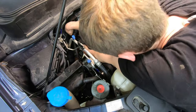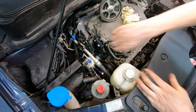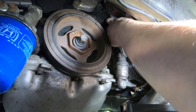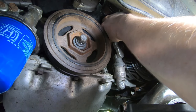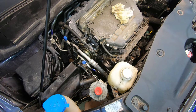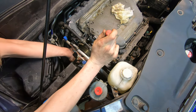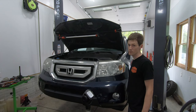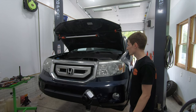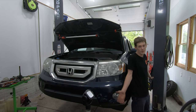Once you have the balancer bolted on the bottom of the engine and torqued down, come back up to the top. Put the two timing belt covers on the front and the rear. Once you get the two timing belt covers on, bolt on the serpentine belt tensioner and start getting the belt back in place. You also have to get the power steering pump bolted back up before you can put the belt on. You can't bolt the serpentine belt tensioner up until the upper timing covers are on.